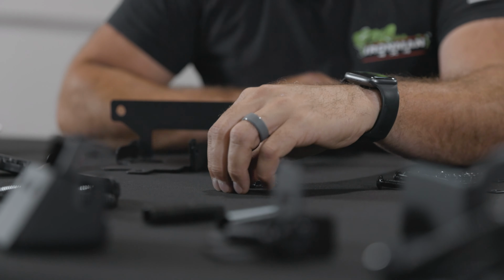Now, while we're holding everything, take your recovery point, and this outside of the recovery point needs to hook around and over that outside reinforcement bracket. Now that we've got that together, take this single bolt plate, we'll feed that through, just like that. I'm gonna take one of these clear plastic retention kind of nut square things. That will just kind of hold it in place for me. We'll grab the double bolt plate, feed that back through everything. So you can see that is the assembly process there. Cool. And that now should hang.